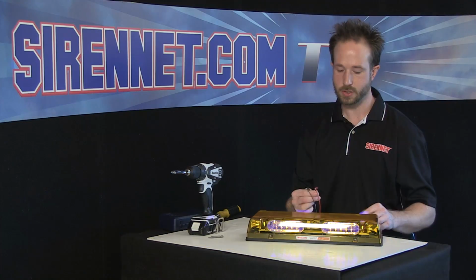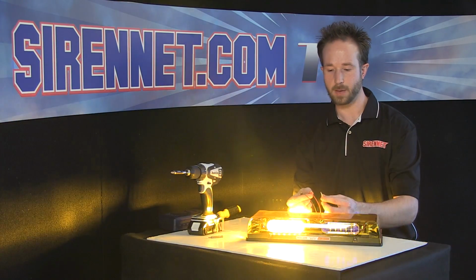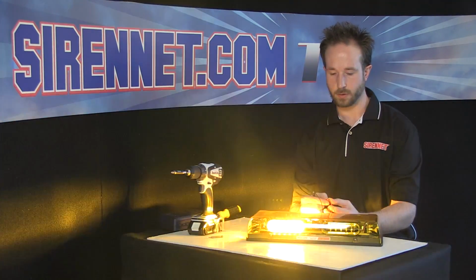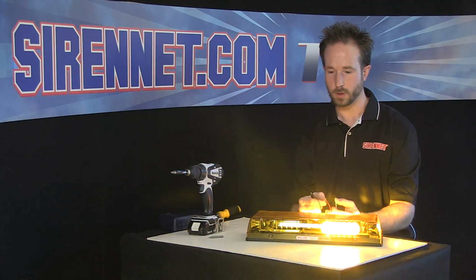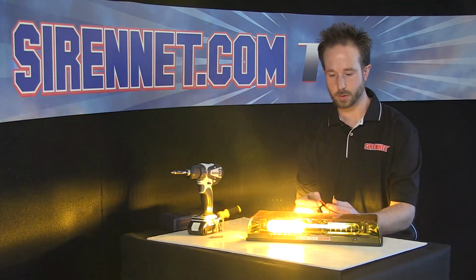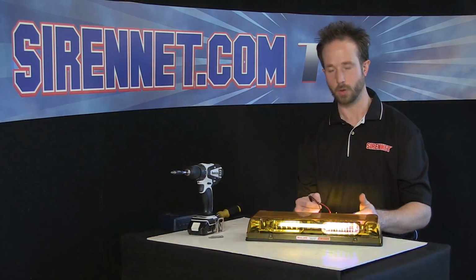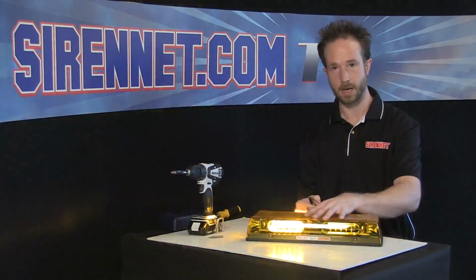Well, say you wanted to change that. Scan lock trigger wire here, momentarily tap it to the 12-volt source, and that advances the flash pattern for the mini bar. Continue to tap it, it'll continue to advance. And once you have it set on something that fits your needs, go ahead, stop the trigger, and there you have it. Pattern will be set. Every time you turn off the power, turn it back on, your flashing will stay the same.